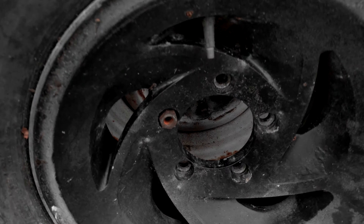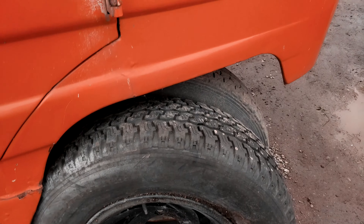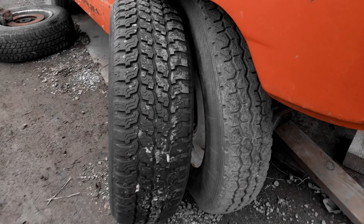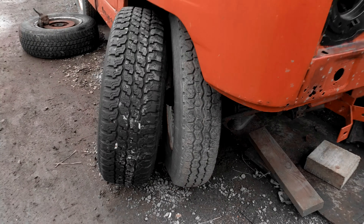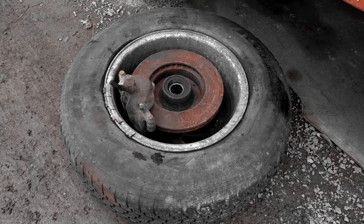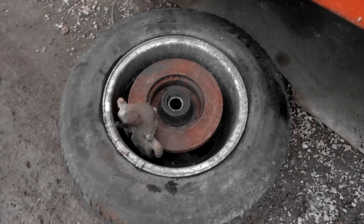Outside, I've done a test alignment of the Suzuki Vitara aftermarket alloys. They're an inch lower overall and a lot wider, so they should help the centre of gravity and grip. Importantly, the disc and caliper setup also clears the rim, so I can get these wheels powder-coated now.